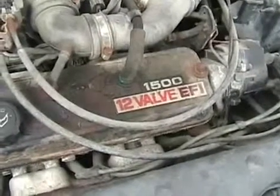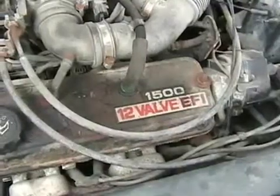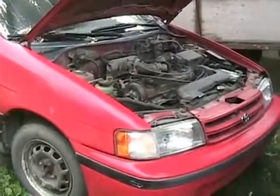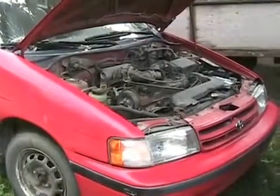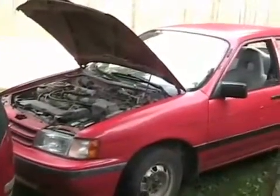Well, without a completely different computer, MAP sensor and electronics for this car and bigger injectors, this Toyota or any other car would not work properly. The intake mixture would be way too lean. Your car couldn't understand pressures above 0 psi and know how to give it more fuel or have the capabilities with larger injectors to do it. So your car would work terrible.